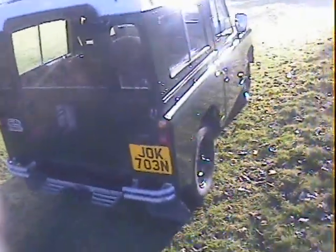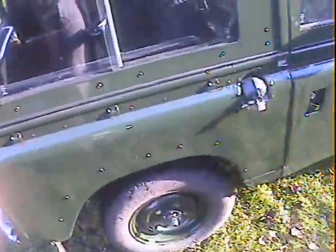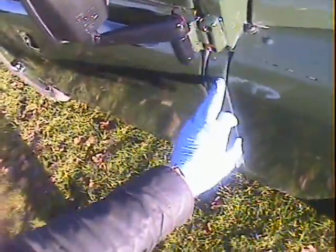Looking down the offside, a couple of barrel-side dents in the driver's door and a couple of ripples in the rear wing, but otherwise all very nice. The driver's door has a bit of electrolytic reaction under the paint on the bottom, right the way along it. The A-post has probably been repaired up there, but the scuttle corner has just a little bit of cracking in the paint — not on the bottom of it — and otherwise it's all very good there. The door tops are in great shape on both sides, and the door card has been replaced with checker plate which gives extra strength. The footwell on the offside is good — there's a repair patch under the accelerator, but it all looks nice.